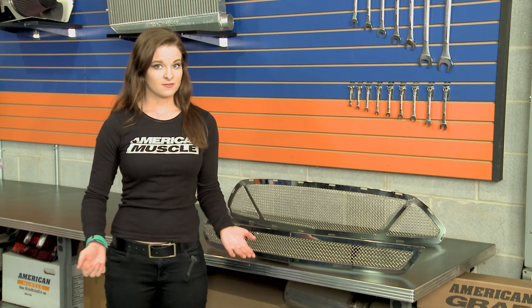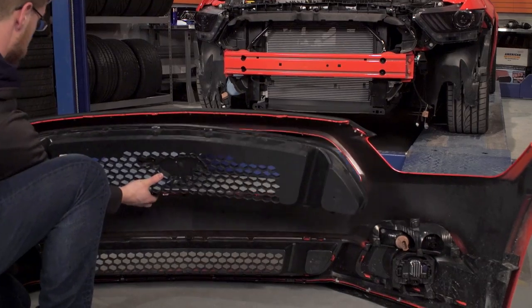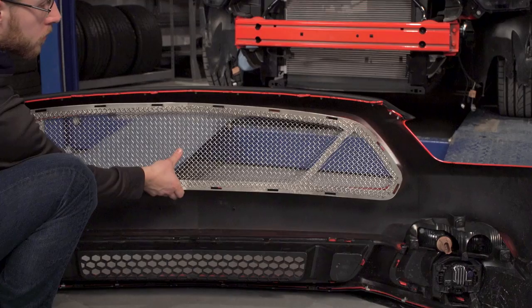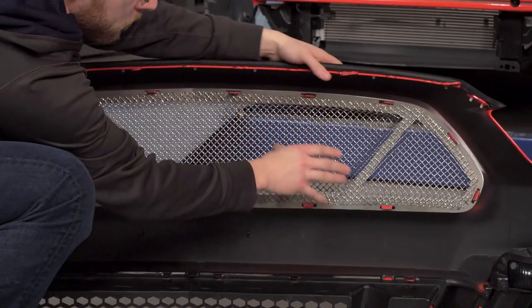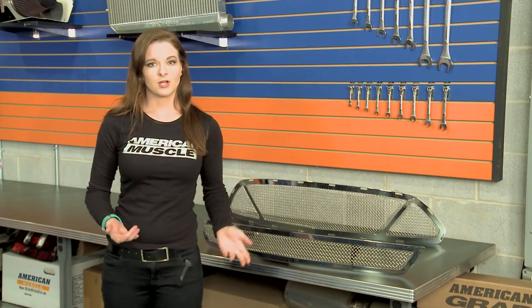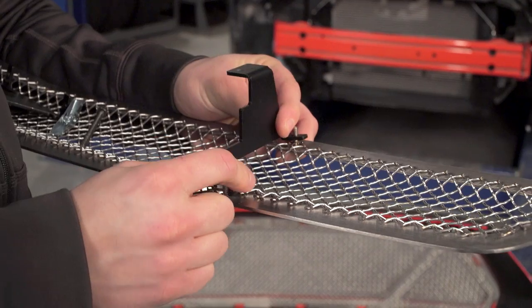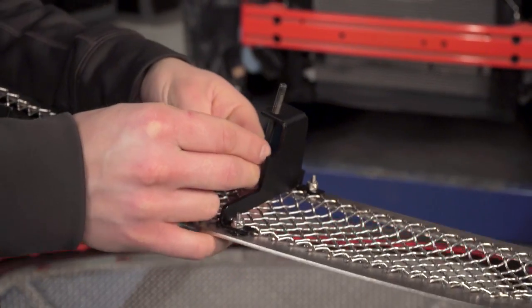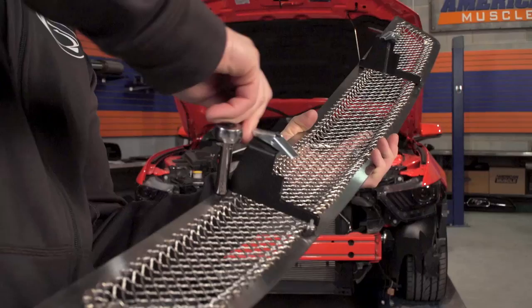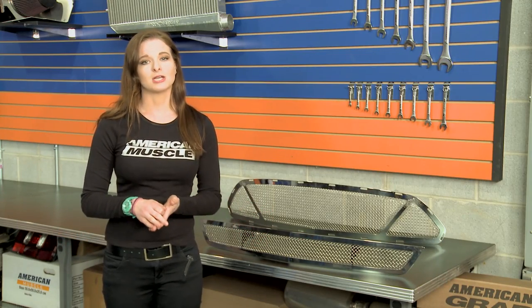Getting the top factory grille out isn't as hard as you might think it is. There's a soft gasket that comes out with a screwdriver, and then you can remove the plastic clips that are along the edge of the factory grille. The new grille installs with the supplied fasteners that go around the factory clips, and then the center bumper soft gasket goes right back in after the new grille. The lower grille is going to go over top of the factory grille, and you're going to need the brackets for the install. The machine screws go through the bracket, and the two wing nuts are then threaded on. The brackets are then fixed to the inside of the bottom bumper mesh, and the lock nuts are tightened down to the mesh frame. Then it's ready to be fixed to the factory grille by tightening down the mesh from the front.